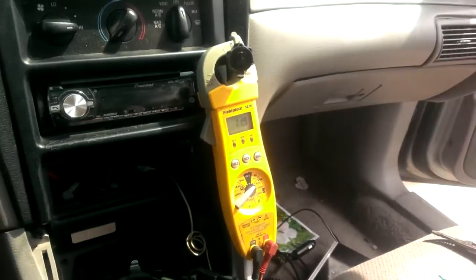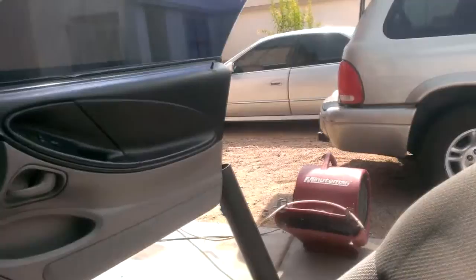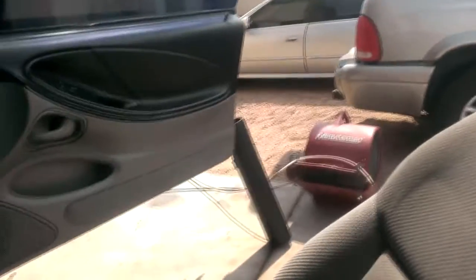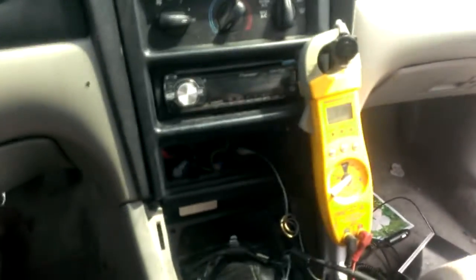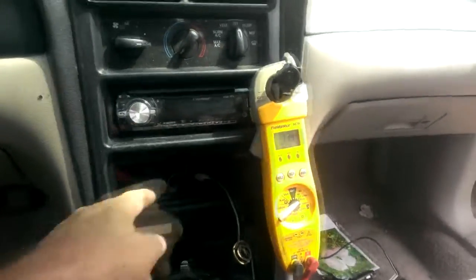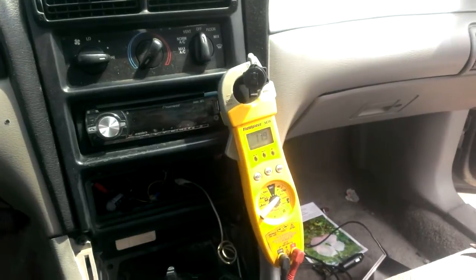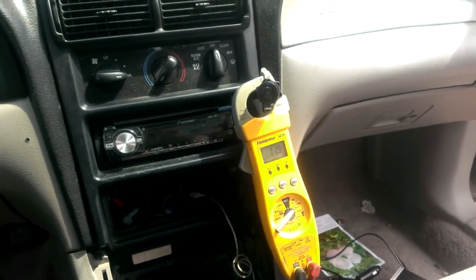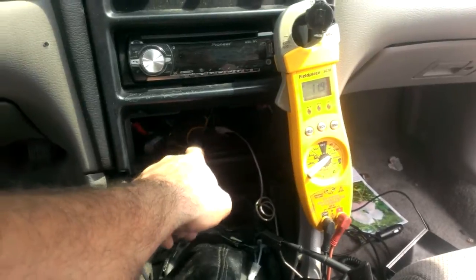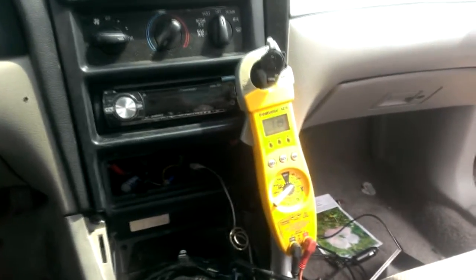I hope that's picking up the audio okay. It's kind of windy because I have that shop cooler — my little cooler with misters blowing air. It's 110 plus out right now, but it would be way too hot to sit in this car without that blowing. It's reading 11.9 volts — it's been dropping a little. I'm also going to lose about 0.7 volts across that diode, so that's normal. The car is probably at more like 12.6 volts. Some diodes drop 0.3 volts, some drop 0.7, depending on silicon or germanium. I'm reading the power coming after the diode into the capacitor, then back to the memory wire on the radio.